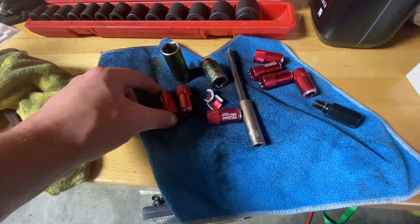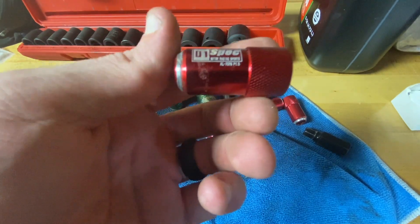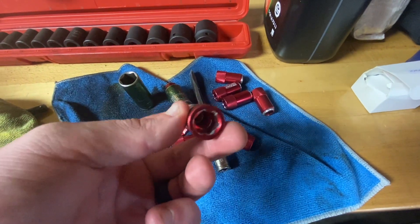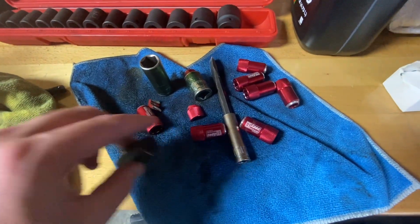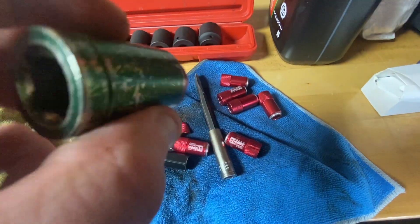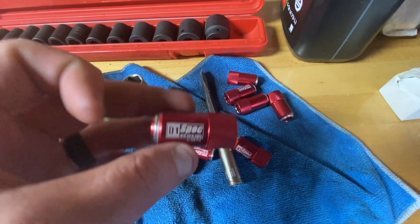If you follow me on Instagram, I had a bit of a fiasco with these lug nuts. These are aluminum D1 Spec lug nuts — they're really cool and spiffy. They have a tool, like a little key, and you stick the key inside the aluminum lug nut and lefty-loosey, it comes right off. Well, it's not exactly that easy sometimes. The key is made of steel and the lug nuts are aluminum, and the steel just busts through these little guys and you're forced to try to finagle the whole lug nut off with what's left. So it's in your best interest, if you buy aftermarket lug nuts, to continue to use steel if you have a durability concern — they won't have this issue.